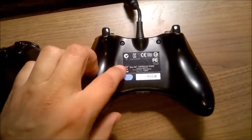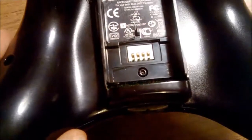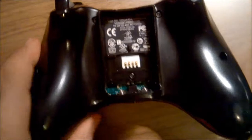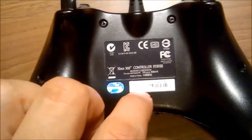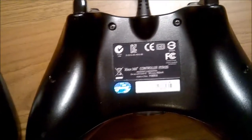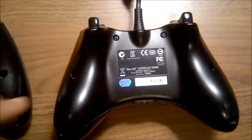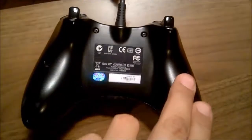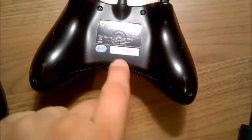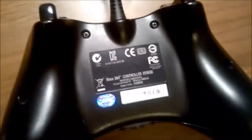If you've never taken one of these apart before, you need to know that you're going to have to remove a sticker. On wireless controllers it's going to be right there underneath the battery pack. Mine's already taken off because I cleaned this one and planned to swap parts. You're going to have to pull this off, and that means you can't use any warranties or send it back to Microsoft anymore. You've got two screws here, two screws in the middle, then two more there, and one underneath the barcode to remove.